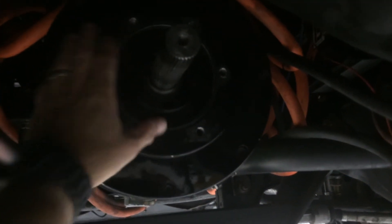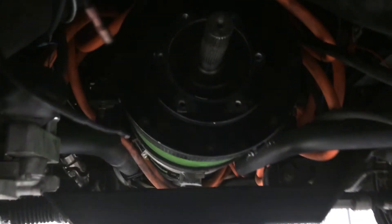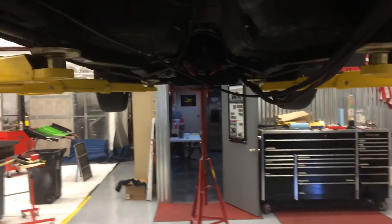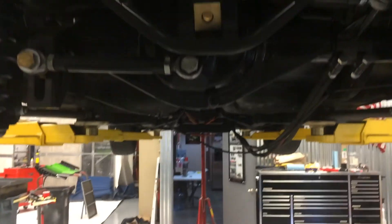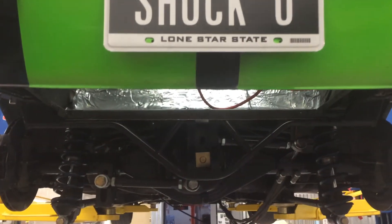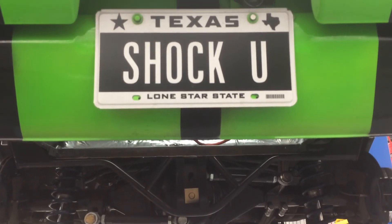Let's take a look at the rear of the motor so you can see how this mounts up. That adapter literally slides over this output spline, which is built into the shaft of the rear motor, and then you bolt it up just like a transmission. It's really that simple, and this is sort of the magic of how we're going to take all the amazing power in those batteries and electric motors and lay them down to try to go potentially 200 miles an hour.